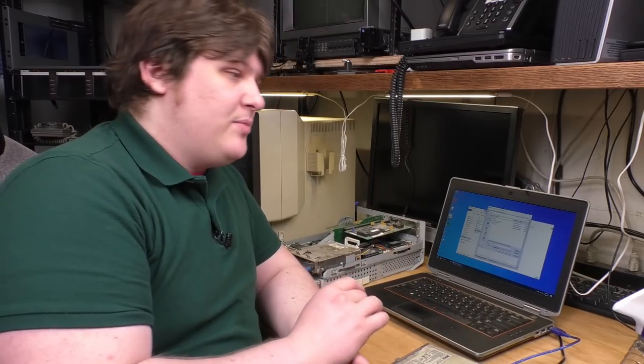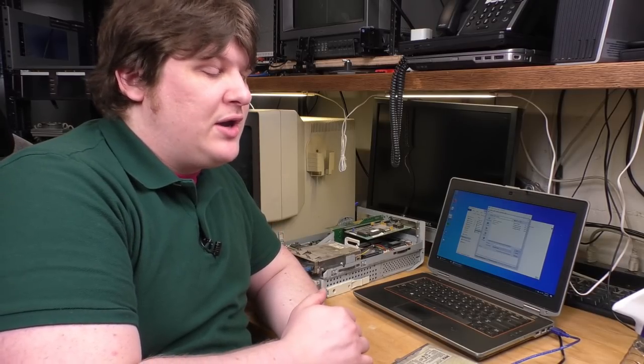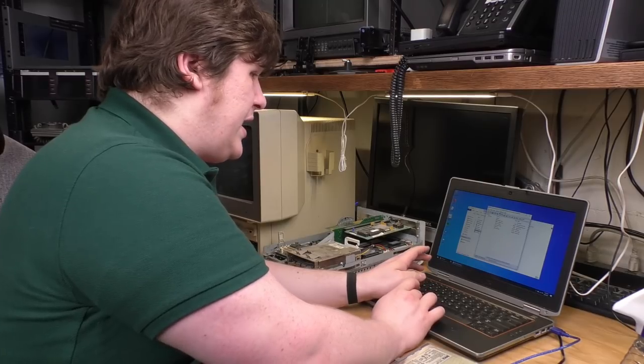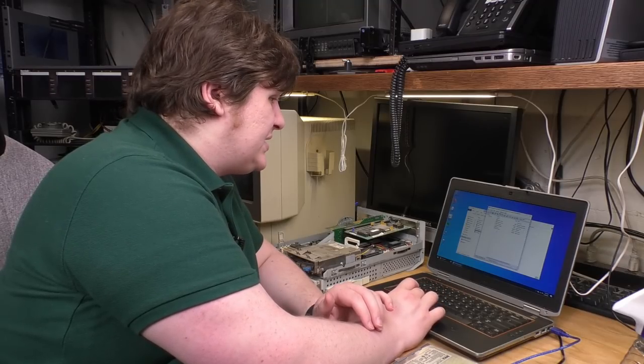If you do this yourself, you want to make sure you save it just as an IMA file. There's nothing wrong with IMZ files, except they don't make them small enough to be worth it on the modern internet, and they're irritating. All right, and now we have an image, and I can now jump into the folder here and take a look at what's actually on this disk.